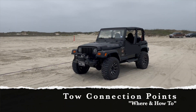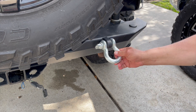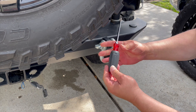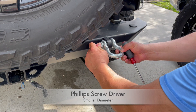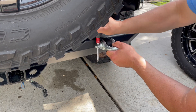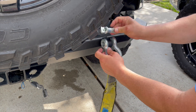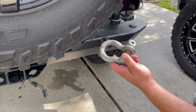Let's learn where you would connect to a recovery vehicle. I'm going to show you just a few basic ways to connect to a vehicle. Let's say there's a D-ring and it's a Jeep and you're using your winch — you could just take a hook, hook it to the D-ring, and that's your connection point. I bring an old screwdriver in my box because sometimes the D-rings are rusted and very hard to remove. So I loosen it up and then I remove it to connect it to the strap, then tighten it back in.